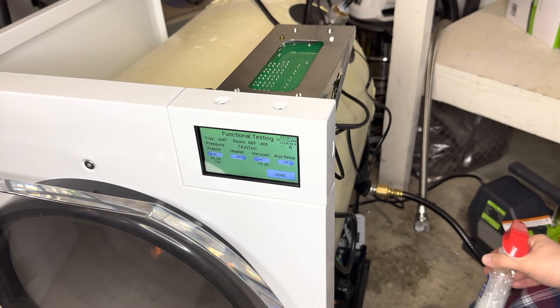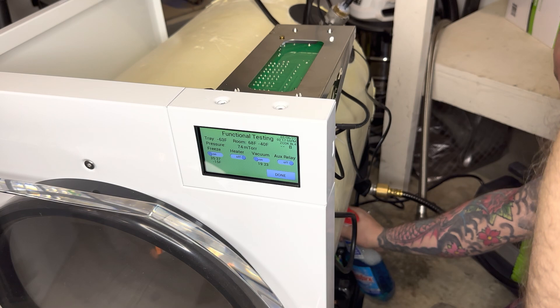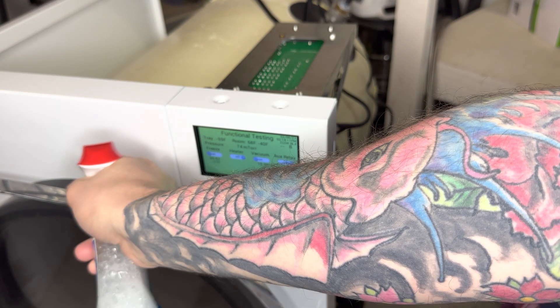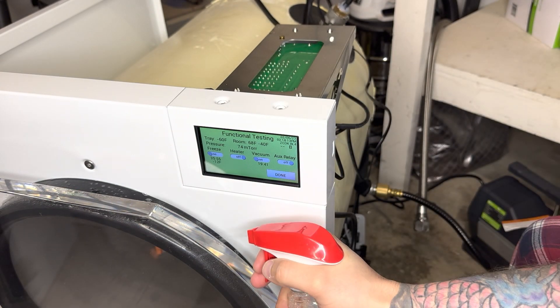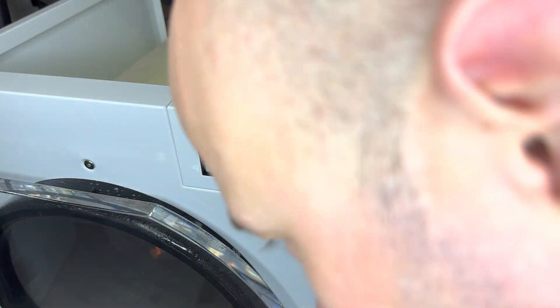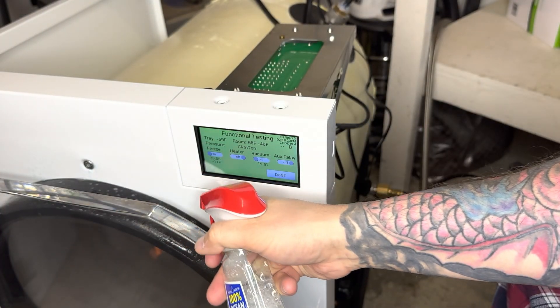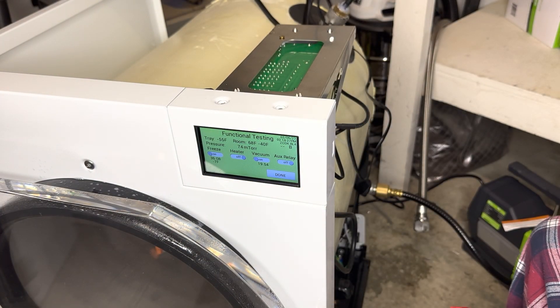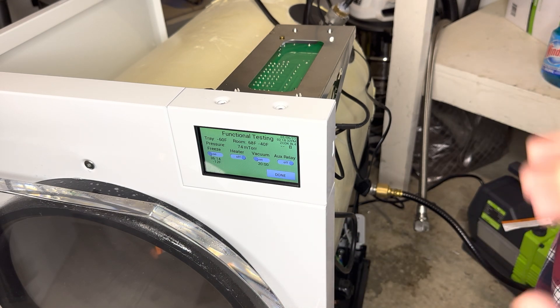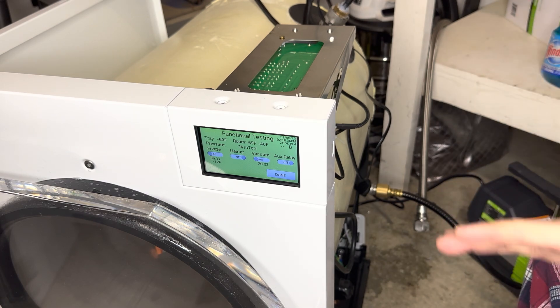I did skip an area — underneath you're going to have the drain valve. So if you spray that area nicely where it connects into the drum, check that area as well. You should see a drastic change in the mTorrs if there's a leak, like we've been talking about. I personally just spray it all with Windex all the way around the bottom and all the way to the sides. Once I confirm there are no leaks, I'll turn off my machine and clean up all the areas I just sprayed with Windex.